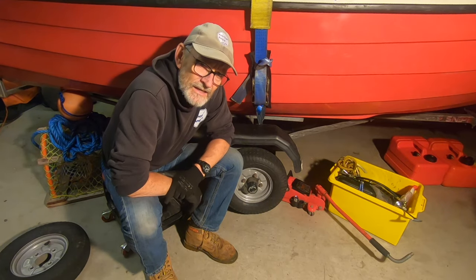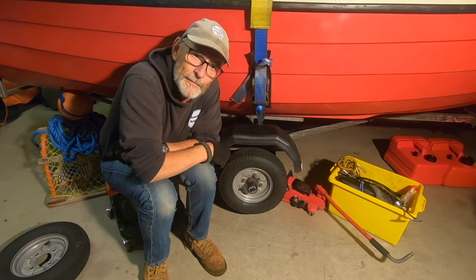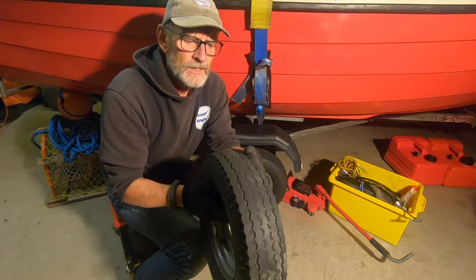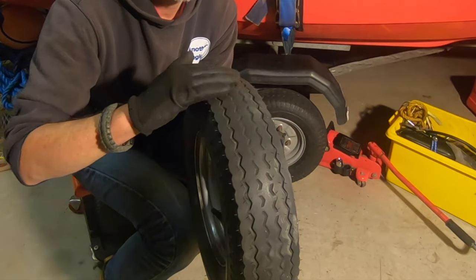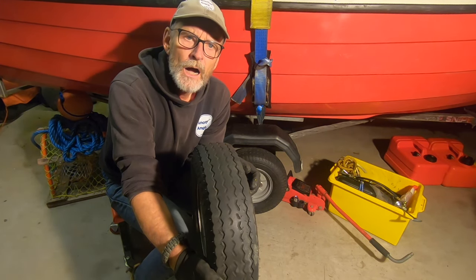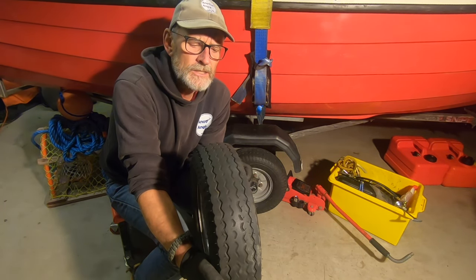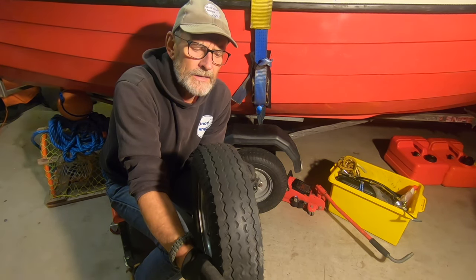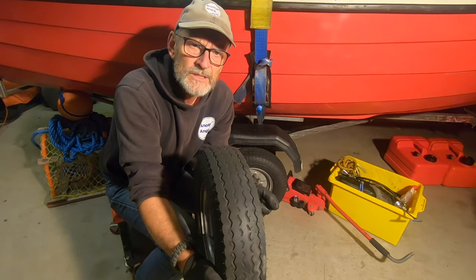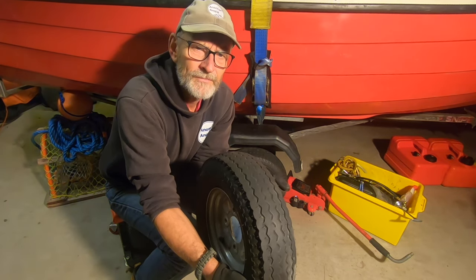The thing I have noticed though is the tires. I've not really had a problem at all with running little eight-inch wheels, they do look a little bit lost in the wheel arches, but the tread has gone. As I said, we've done about 8,000 miles. I looked on the Wayfarer dinghy website and they suggested running these at about 50 psi. I think that's too much — it looks like it's worn the center out rather than the sides, implying the pressure has been too high and we've been running a slightly bulged tire.